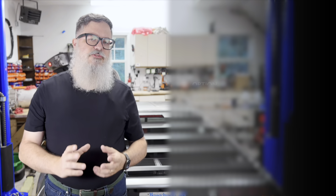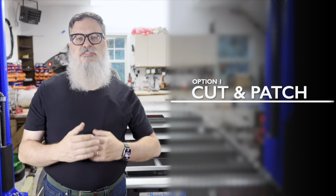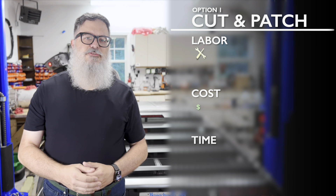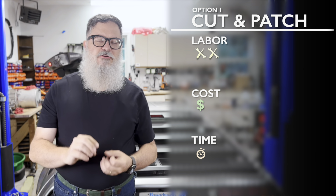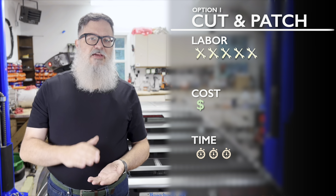There were a few ways I could try to fix this. My first thought was to just cut out all the damaged parts and weld in a new thicker steel plate. I figured that if I used thick enough steel, I could brute force my way around that reinforcement arch. This seems like an easy solution, but the problem is access. The body sits just a few inches above the tower and it'll be hard to get a torch in there, much less finding a way to cut out all the bad parts without damaging the body. This means I'd have to remove the body.